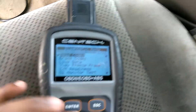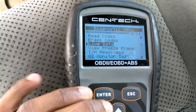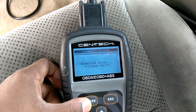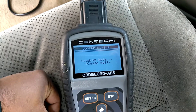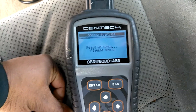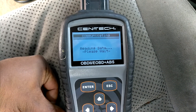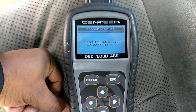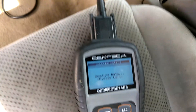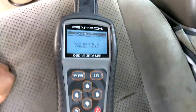So what I told him to do — check this out. We turned it on, got the computer connected, and we're going to go to live data. Press enter. Now it's going to be a little tricky because these drive-by-wire systems don't necessarily let you take off the intake, since the mass airflow sensor is detecting how much air is going in. And it's about 39 degrees outside right now. Let me get the key — there we go. Now crank it up. Live data, because it needs to be live to read the data.